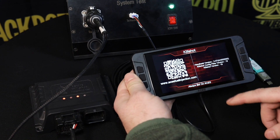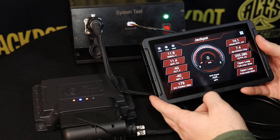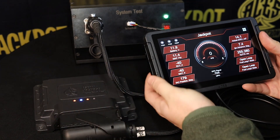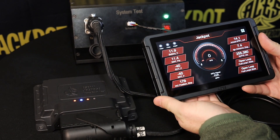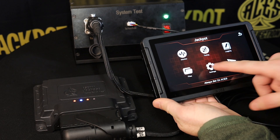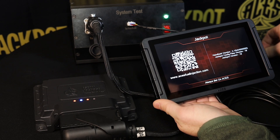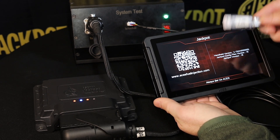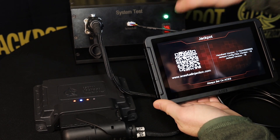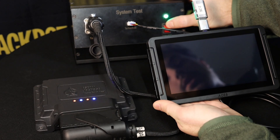In this next part, we're going to show you guys how to upgrade the software on your 7-inch Pro Dash, and this time we're going to be using a Jackpot LS ECU. The process should be pretty similar, but we'll walk you through it just in case. We go into settings, hit about — you can see the handheld version for the Pro Dash is 2.15. I've already got my 2.26 software, which is the latest at the time of this video. So we're going to turn the power off, put the USB into the top, and turn it on to let it run its course.